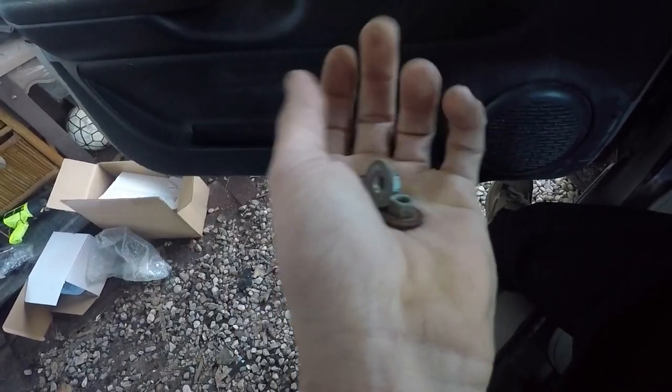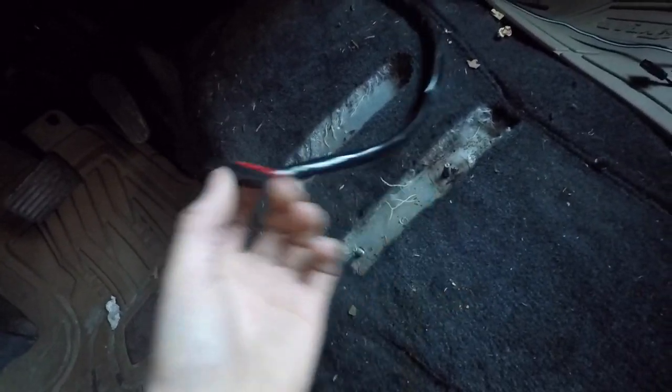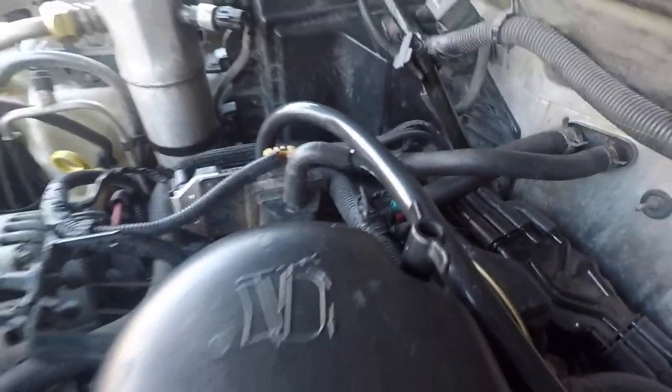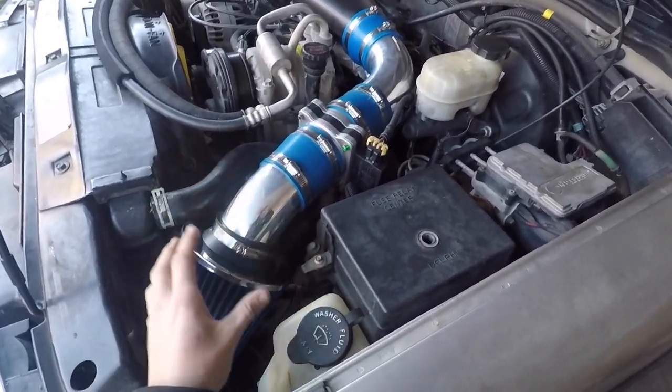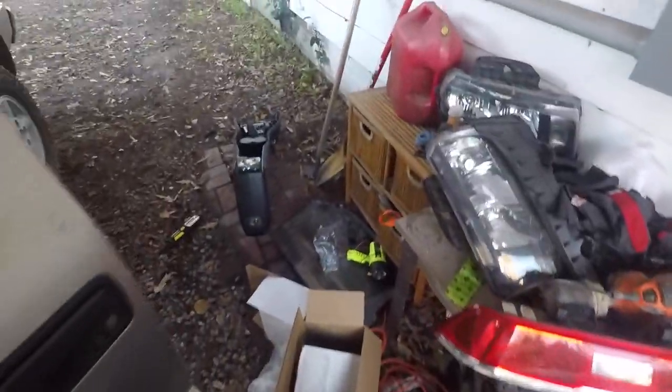You can see that these bolts have a little bit of corrosion on them. This wiring harness is just the plug-in for the cassette player, and it just kind of sits there freely. I would not recommend you cut this just because this runs to the wiring harness, which ends up running right up over here on top of the intake. So if you cut that, you could run into some problems. If you want to see the intake video, make sure you check the channel — I did a video on those $30 eBay and Amazon intakes and whether they're really good or not.